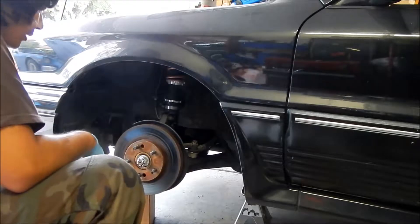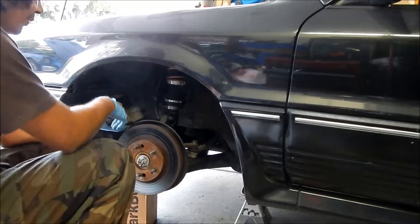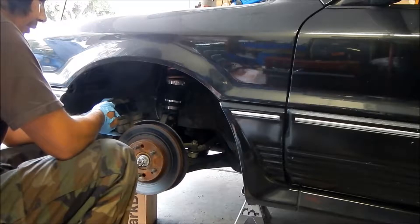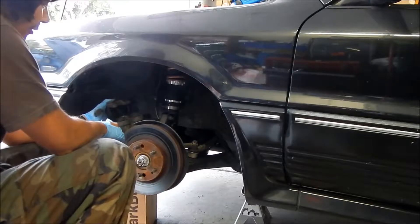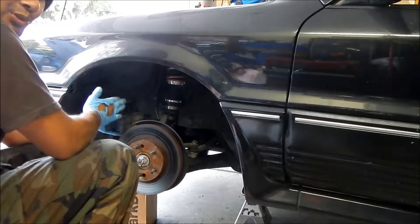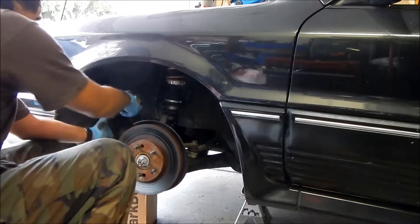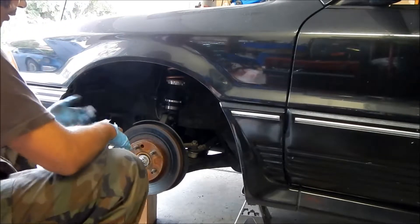So what I'm going to try to do is work this caliper in. I'm going to try to push it in with a clamp, and then push it back out using the brake pedal. Hopefully I'm going to push it out too much, I'm just going to brake a very little bit, just to get the pistons moving in and out, and then see if it moves smoothly. If it doesn't, it's probably going to need to be rebuilt, and I'm probably going to have to just buy a whole new caliper — or a refurbished one.